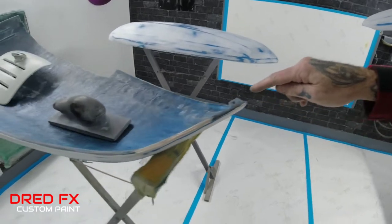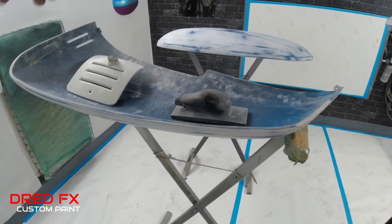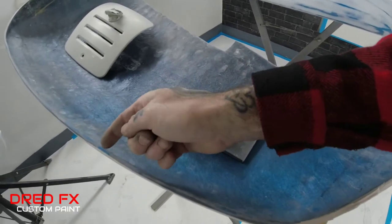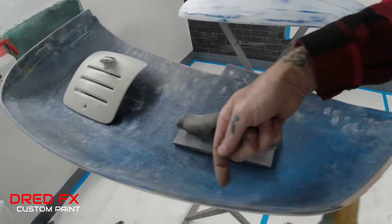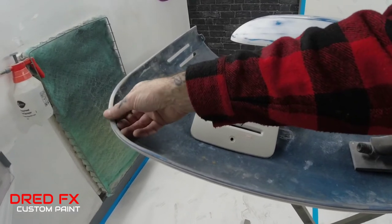So we can move on after that's prepped — clean everything down, wax and grease remover again, give it a good clean. And then we're going to drop some plastic primer on the edges. Any edges that are broke through, like these edges here — I've had to really sand these out — plastic prime all these edges so the plastic primer goes round the edge and all in here to give a good area for the paint to bond to.